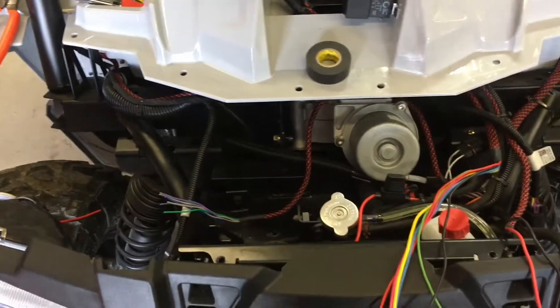The Razor headlights just bolt into this stud - the two on the bottom - just make sure you get the right stud alignment. I didn't run the horn yet but I can wire it in later. This ended up being pretty clean. I didn't modify much of the headlight harness - it had plenty of excess wiring, so I just unhooked the clip, ran it over, and bought 886-style male/female pigtail connections for the low beam.